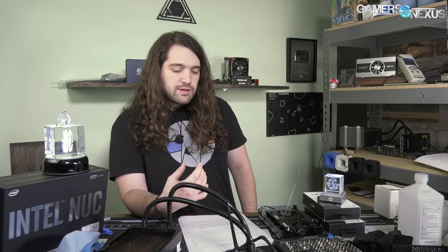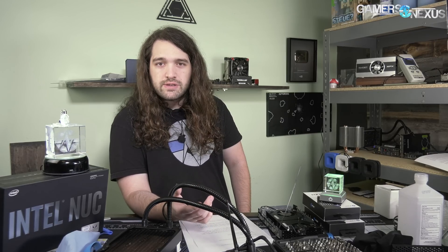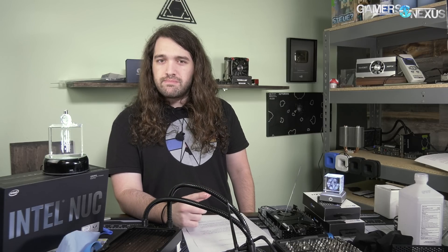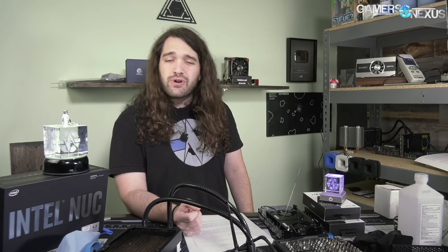The plan is to fix mounting pressure or put an even bigger cooler on it. We also ran CL19 at 2933 MHz for the HyperX memory — the high-end NUC at around $1,200 with an i7 and the Vega M high-end mobile GPU. On the GPU we're between 1340 and 1370 MHz, typically 1370, up from 1320 MHz. HBM2 is at 950 MHz max, sometimes 935 MHz depending on game stability, up from 900 MHz. Overall: 400–500 MHz extra on the CPU overclock, 50 MHz extra on the GPU, and 50 MHz extra on the HBM2 — depending on the title.